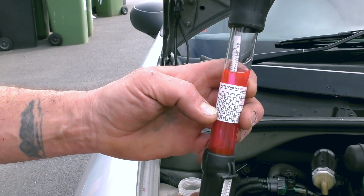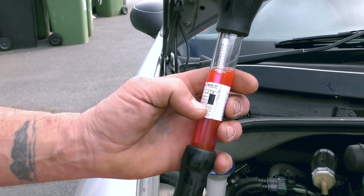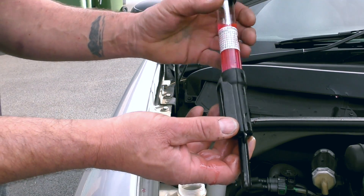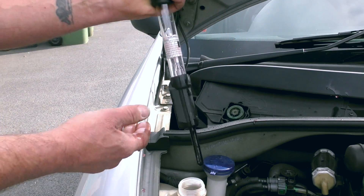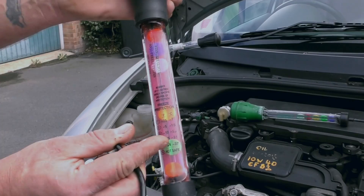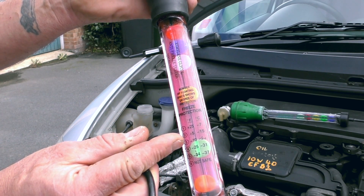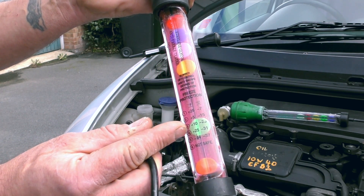So my preferred choice is this one. What you need to do is just get a rough guide for the winter, and you do need to check your antifreeze now. You should have it in all year round, however the weather is now going to get colder so you are going to need protection. A friend of mine years ago had a Ford Transit. He only used water as coolant. Surprise - winter snap freeze, and the ice blew his core plugs out of his cylinder block. So be warned. Anyone who has a little bit of an autistic streak might actually notice that these are discs and not balls, but I prefer to say balls because balls sounds better. These are actually floating discs. I hope you enjoyed that - see you in the next video.